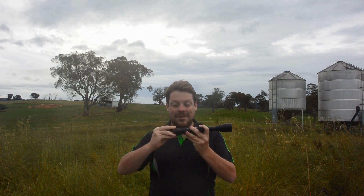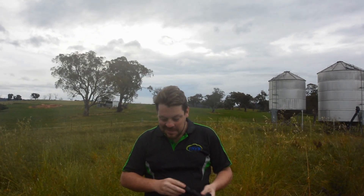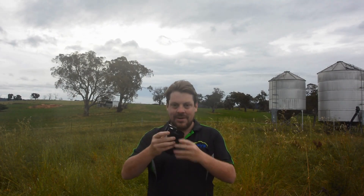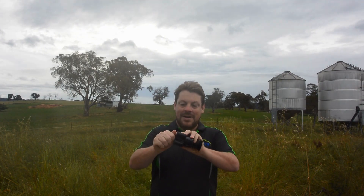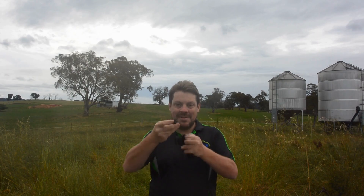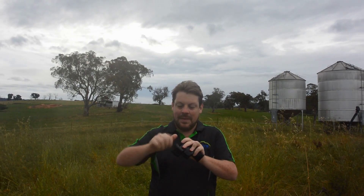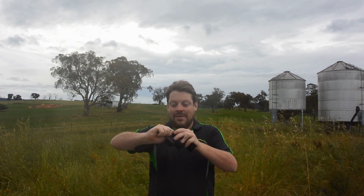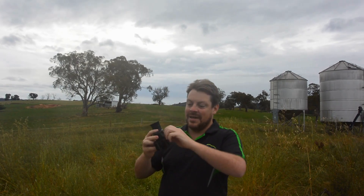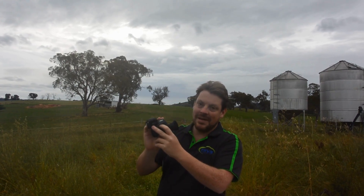This one does have a bit of focus on here, but we won't be using that just to show you how it all attaches. First thing you want to do: get your unit, put your battery in. On the front here, this just unscrews. Please be aware when the batteries come, they do come with a little bit of black tape on there — you do need to take that off to get the unit to work. Once you've popped that off, get that in. If you're going to be recording anything, you'll also want to have your SD card in there. On the left-hand side, you've got a little flap — pop that away, that's where your SD card goes.